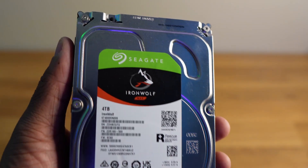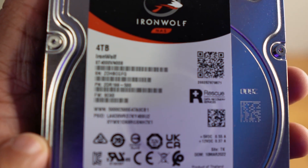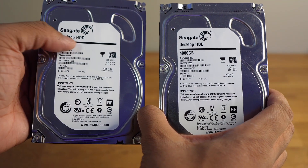Next up is the drives. The amount of drives you're going to have depends on how much money you want to spend. In my case, I had a lot of these drives lying around. Previously I had a 4TB NAS drive, a 4TB regular drive, and a 1.5TB drive — they were just sitting in my closet so I hopped them into my case. Ideally, you're going to want to make sure that all your drives are NAS-certified drives, meaning they are suited for longer run times — 24x7, 365 — versus a regular hard drive which is only supposed to be on when you need it. Also if you're building this from scratch, you might want to look into RAID, which is when you have all drives of the same size and manufacturer, and you can do things like double the speeds or have redundancy for backup purposes. In my case I just had a bunch of drives lying around, so I can't really do too much with RAID.